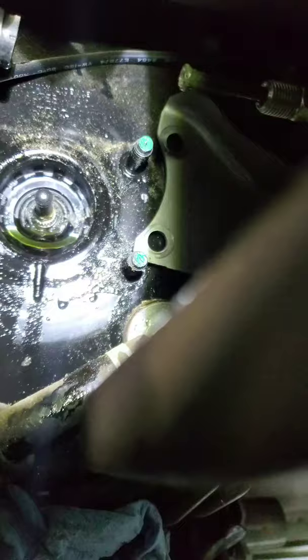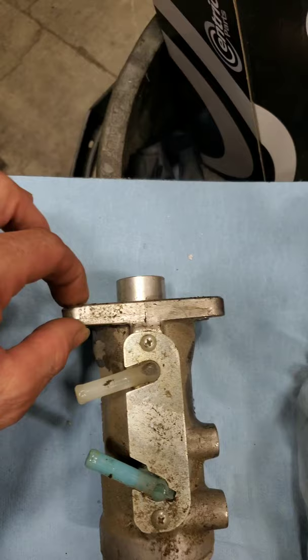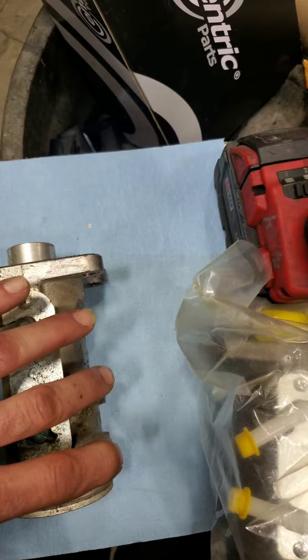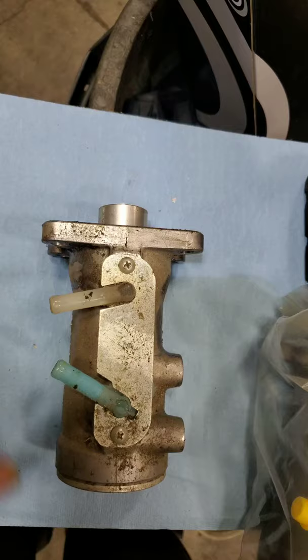We're loose — going to work that out. We got that unit out. Right there are both of the bolt holes. Here is our old master cylinder. It had a pinch clamp here and a pinch clamp here. The bolts that hold it to the firewall or the booster are 12 millimeter nuts. These two brake lines are 10 mil — they didn't feel like they were torqued on too tight, just a healthy snug. Those two pinch clamps and two lines just let them both off.